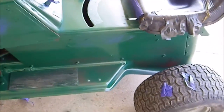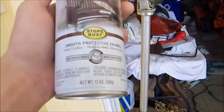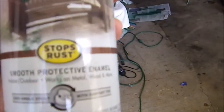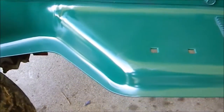I'll just cover everything again and get another layer on there. The paint I'm using is Rustoleum - it's a satin, not semi-gloss. It's an enamel and it has stop-rust stuff in it too, so it should prevent rusting in any areas of metal that had a little bit of rust on it - like right down there. I ground that down to bare metal, and right up there too. I added some bare metal on it also, so it should stop it from rusting.